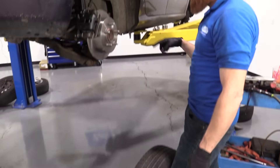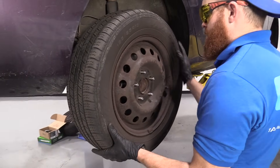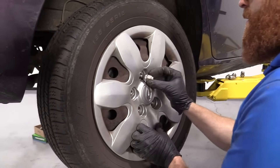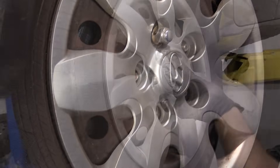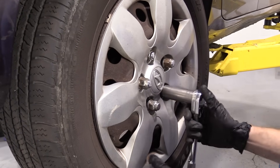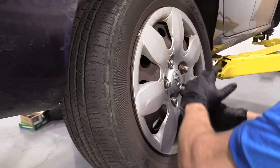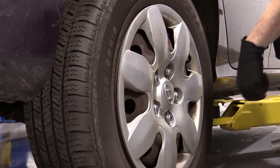It's time to get the wheel up on here. We've got our lug nuts close, we've got our hubcap. I'm just going to take it and roll it up my leg. Get it on there. Take my hubcap — we've got our little slot right there where our valve stem goes through. Get one lug nut on while I'm still holding it. The wheel can't fall off, now I'm going to grab the others. 21 millimeter — I'm just going to bottom these out. I want to make sure that we do this in a star pattern so the wheel won't get kinked. If I tighten adjacent ones, the wheel might be sitting crooked and I might think I have them tightened down but really they're not. Air gun would make short work of this. Time to torque this down — 21 millimeter star pattern — 80 foot-pounds.